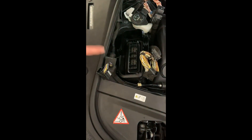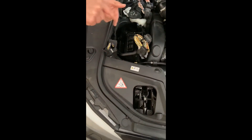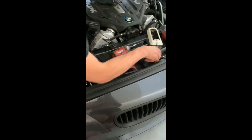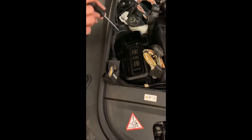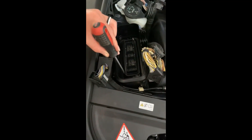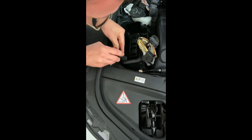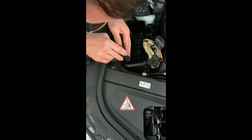Now you have your DME. The next thing you need to do is disconnect the two coolant lines — they have blue tabs that you push down and then push the hose off. Due to the age of the car, I've broken the tab on this one on two different cars. Just be prepared for that; if the coolant hose breaks you have to buy a new one — they're not that expensive, about 30 bucks. Push that blue tab straight down and use a screwdriver at the same time to push the hose out, on both sides.